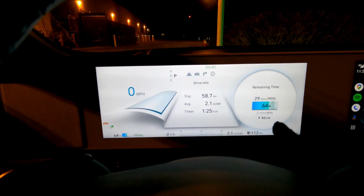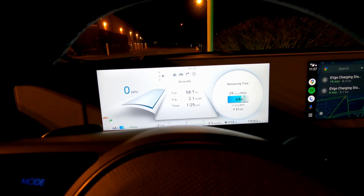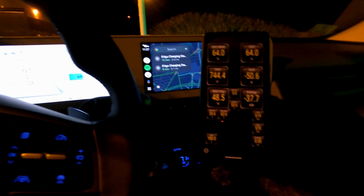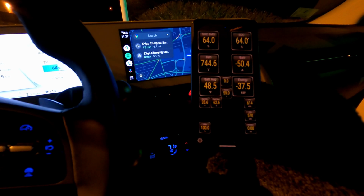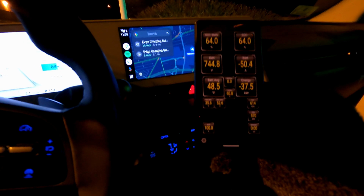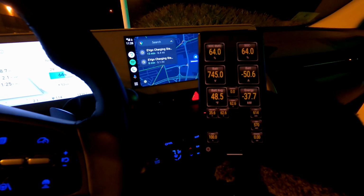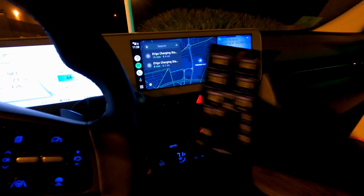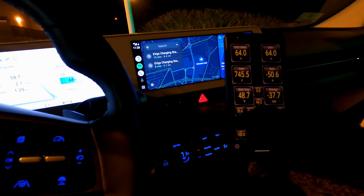stations before. We're starting up at this lower rate, and that's really just this reminder of how quickly the pack can cool. Because remember, we had done a good 40-45 minutes on the way to Auburn of battery conditioning, and we got the pack up to that toasty kind of 70s and 80s, and the heater was all the way up to the hundreds of degrees Fahrenheit. But even on that, it was more than an hour ago that we unplugged in Auburn, but remember we had that charge session at the EVgo there, and the pack has cooled all the way down to this 35 degrees minimum. So again, you're going to get this slow charge rate.